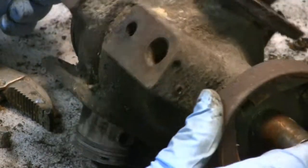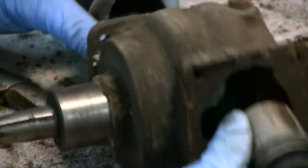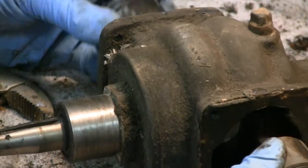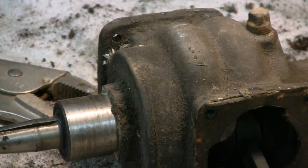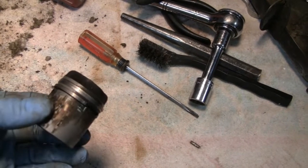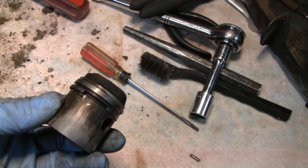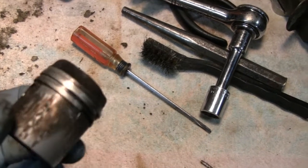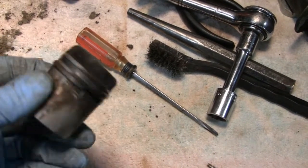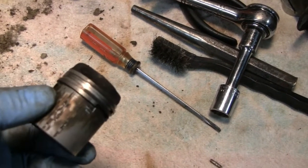I think that's as far as we're going to go now. I think I'm just going to clean the rest of it up. Everything seems to be pretty good on it, everything seems pretty tight. We'll clean this up and then maybe we'll make a few videos of that. I took this one piston out and I was looking at the rings and cleaning them, and I noticed this one ring has a big hunk missing out of it. So it looks like we're going to have to buy a set of rings at least. The piston looks like it could be cleaned up and straightened up a little bit, but I might wind up getting another piston too. We'll see — we'll start with a set of rings.